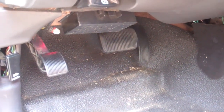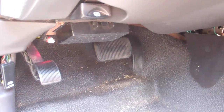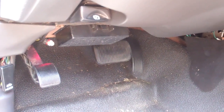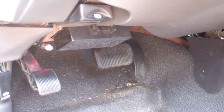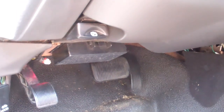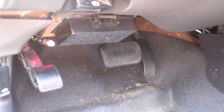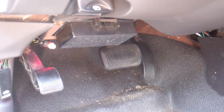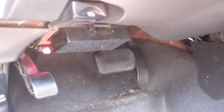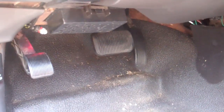The other possibility is that police cars are often equipped with a switch that turns off the brake lights. Because both of these switches would be wired through your brake system, if you find a switch down here that looks like it was at one time hooked up to your brakes, that's why. It's also another reason why if your brake lights are not working, you may need to check under there — they may not have reconnected the brake switch properly when the car was decommissioned.